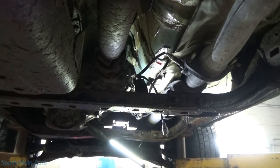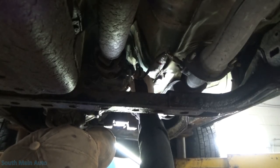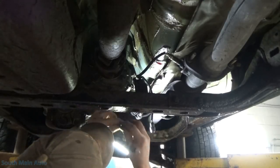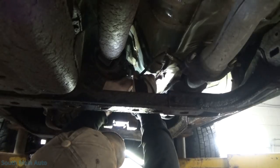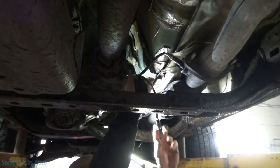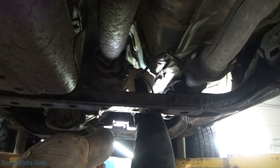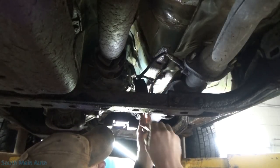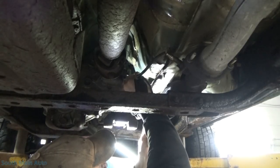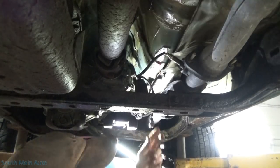Let me double check the background. The diagram must be wrong. So we'll look at where this plugs in — we need to see which way that plugs in. The two black wires are going to be our heater. So it's going to be white with red, or red with white. We're going to go from our heater control — battery positive — and come across the heater circuit. It should light up on us, but it does not.